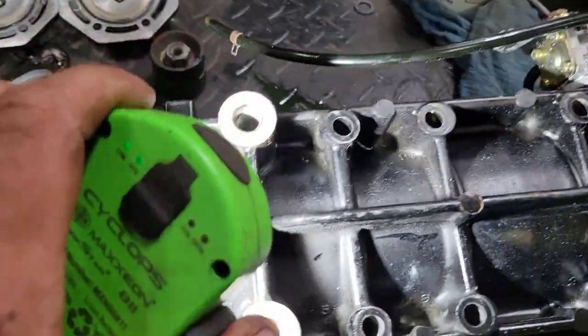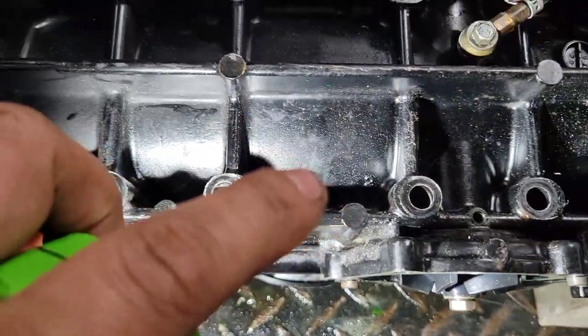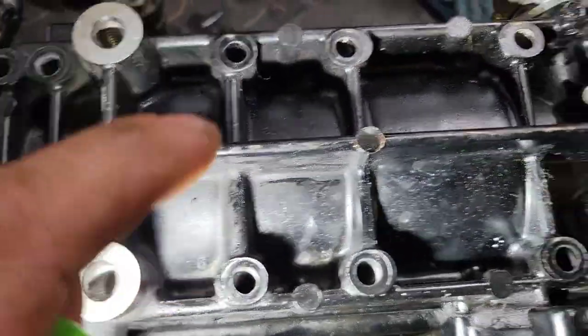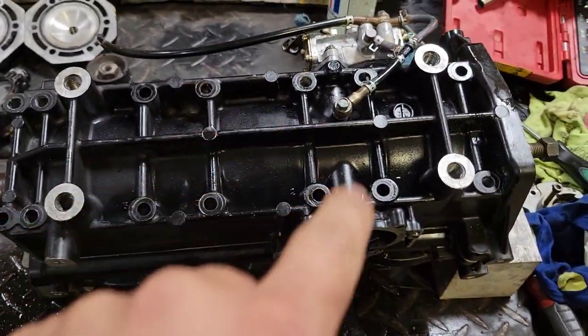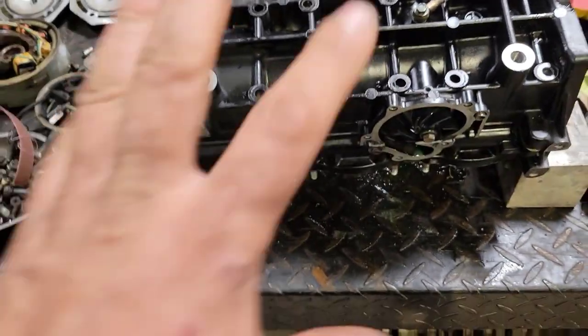I don't know if you can see that, but we got a one down in there, and then 2, 3, 4, 5, 6, 7, and so on. So basically, this being aluminum, you just start in the middle and it's just crisscrossing, working your way like a circle all the way out to the outside, to stop it from warping.